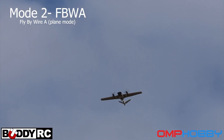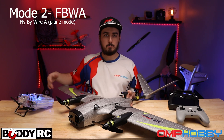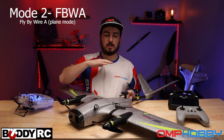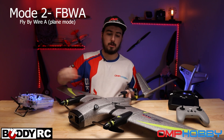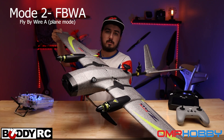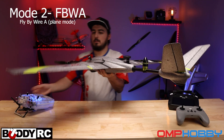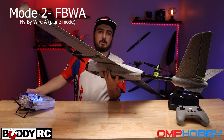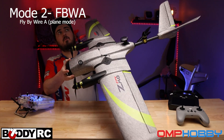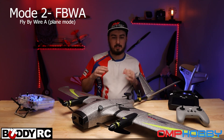The really cool part about it is the bank angle limiting, so it's super simple to fly. You don't really have to worry about knowing how to fly a plane. If you get into trouble, you can always flip the return home mode — it'll come back, switch into Q Loiter mode, and land. It is absolutely amazing. Right now we have it limited to 60 degrees of bank angle, so it will go up to 60 degrees and then level out when you let off the sticks. You can limit it like that and do a whole bunch of different limiting when it comes to the control surfaces. It's a very easy to fly plane.